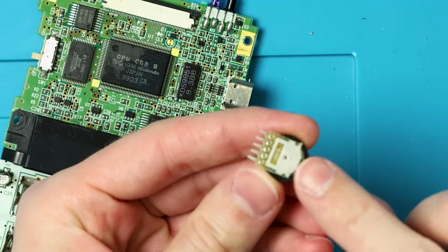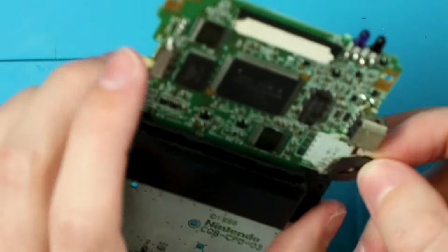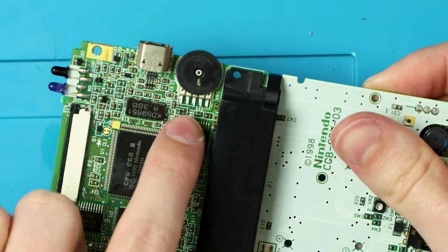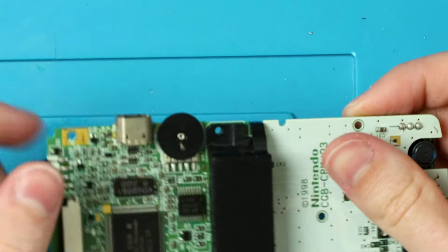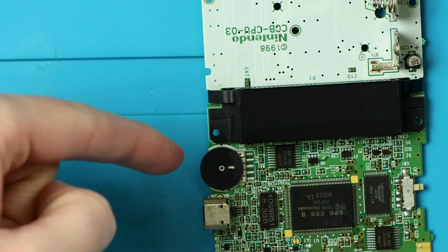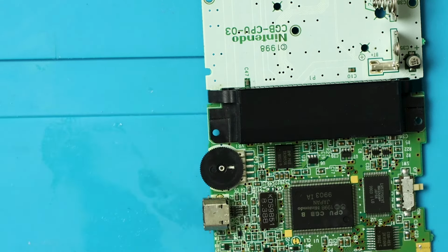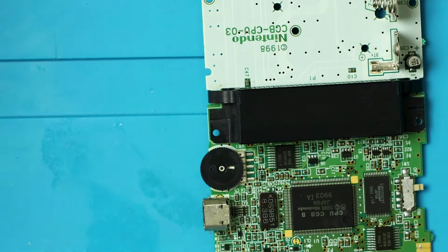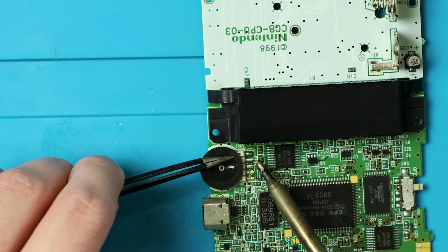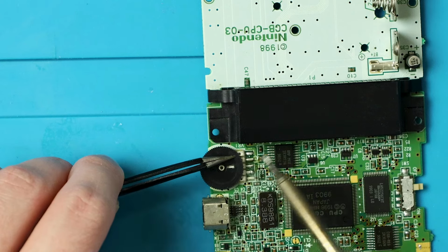And we can literally just stick these 2 pins down in the 2 holes. And then we can solder them down over here, or we can solder them down over here. Well, we have to do both sides, but I'm going to start with this side. Normally, I would solder the 2 anchor points. Well, not normally with this, but normally with other things that have the anchor points, the through hole pins. But I feel like if I hang it upside down, it's just going to not be lined up. So this will probably be easier. I will put down some flux again because these pins are actually kind of long. The flux will help get the solder underneath and all around so it actually connects to the board, hopefully.